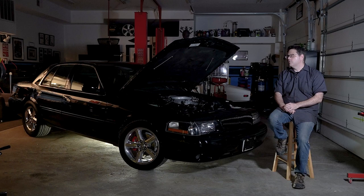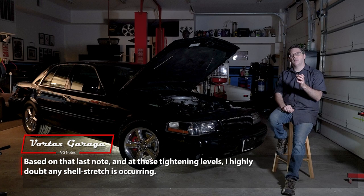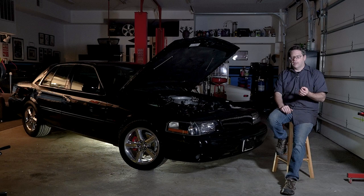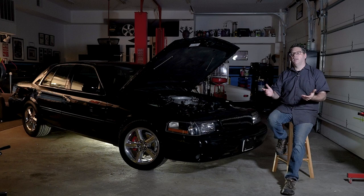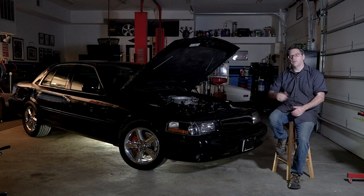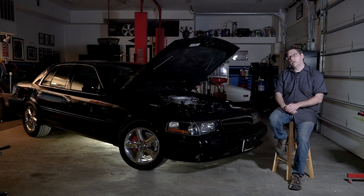When you're dealing with older aluminum cylinder heads, you certainly don't want to gall up a thread. And with forced induction, you're changing the heat range. In a race application, 100% follow NGK's recommendations — changing the heat range on the plug is going to drastically impact a higher-strung race engine more so than a street-driven engine, especially one with relatively low boost. On the street, on the next plug change — which won't be too long since I've done the fuel pump swap — I'll probably go ahead and follow NGK's recommendations.